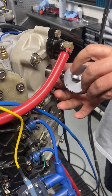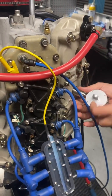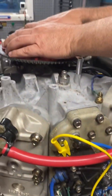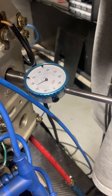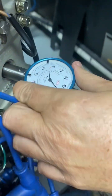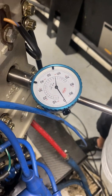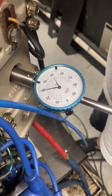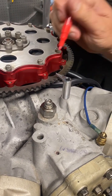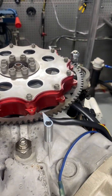Remove the indicator and switch to cylinder number three. This doesn't need to be tight, but whatever faces straight up and down. Clockwise motor again, so we're going clockwise. There's your TDC right there. Now we're going counterclockwise again, 150 thousandths. Take your marker, put a mark. One thing you want to do is line this pointer up to the center of the crankshaft each time — that way you have repeatability when you go to do it again.